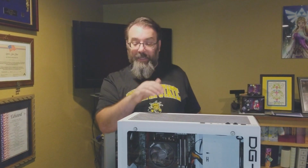There wasn't a huge difference between her old main board, which was the Crosshair 3, and this board, the Crosshair 5, other than one's an AM2 and this one's an AM3. But driver-wise, I believe they're all the same drivers, so I shouldn't have to really worry about much. It should be a pretty easy boot in. So I'll look at it and see performance. If needed, I'll go ahead and reinstall Windows.